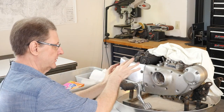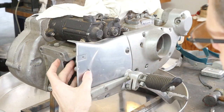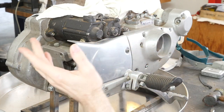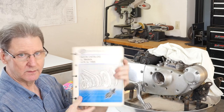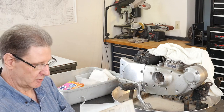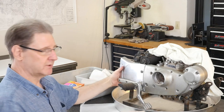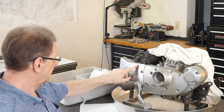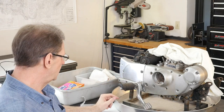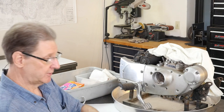This cover, I don't think, goes to this year, because you might see over on this other camera that this goes into air. So either it's missing an inner or an outer. This is where, like I told you, the parts manual, pay for it. You can go back and look and see there's at least three different sprocket covers. There's a steel inner that they used in '79, which shouldn't apply to this. This does look like an '82 cover, but why it doesn't line up back here is going to be a mystery for a later show.